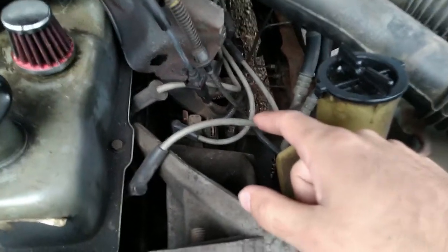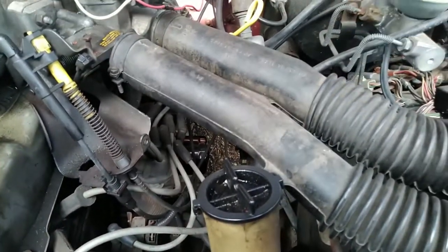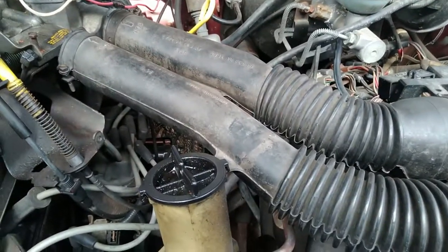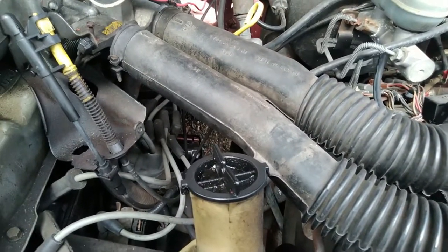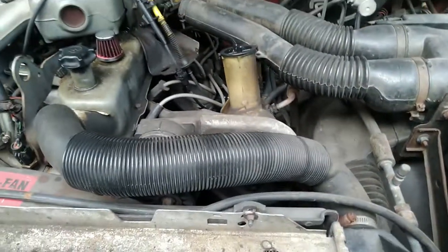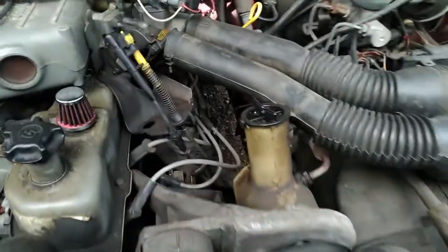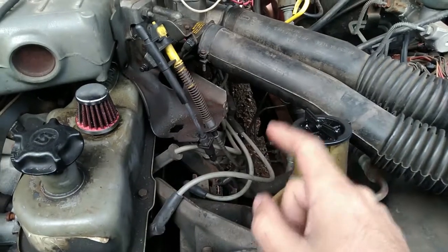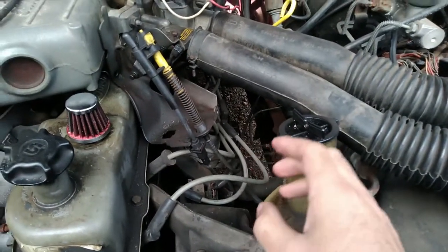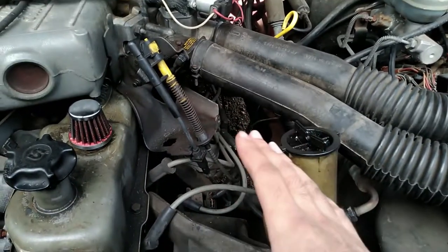That worked for limiting damage and I was unsure what exactly had happened for a while. A few days ago I went to change my oil. I had a pan under there expecting oil to drain out when I removed the filter — but instead that filter was empty, which is not something you should typically see. That's what made me realize the check valve in the old filter was not working and it was allowing the oil to drain back. I was dry-starting the system every single time.